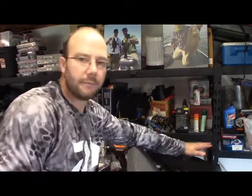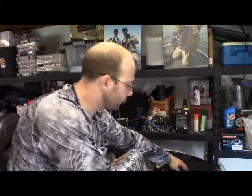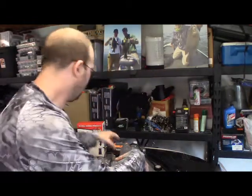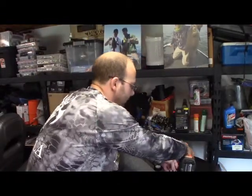Hey guys, so one of the things you may find is where your power cord is and where your power source for your rear light come through are really close to each other. I have my remote oil fill right in between them, so it's really hard to get around them. So what I'm doing is I'm actually going to remove the 3 screws that hold that power source out for the pole that has a light on it, or the anchor light pole. And what that's going to allow me to do is see all my electrical connections. Instead of being underneath in the back battery compartment trying to do everything tight, I'll run that wire up and out, and I'll be able to show you the connection outside of the boat, and then just push it back in and run some zip ties underneath, as opposed to trying to do everything on your back, slunched into the back battery compartment.